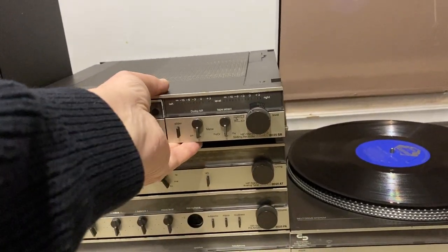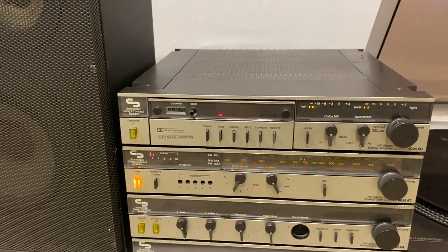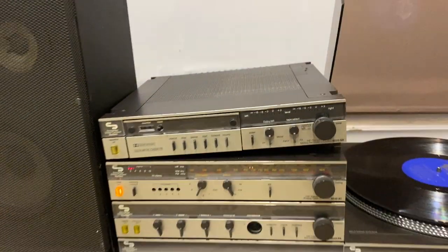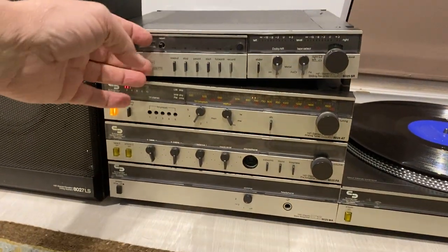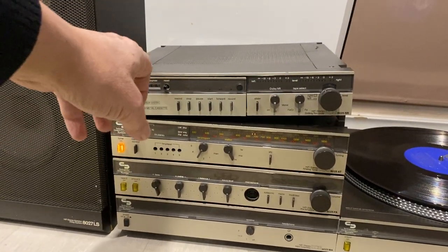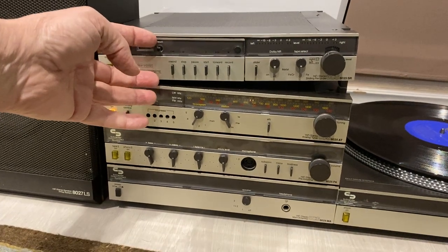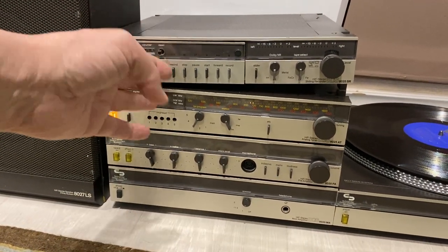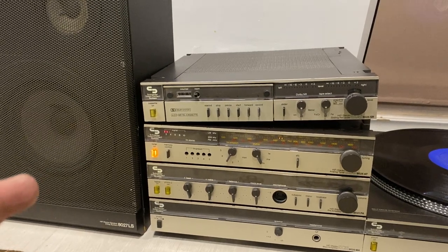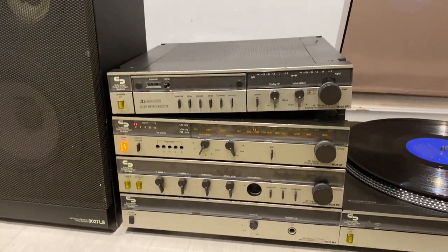Let me just flop this tape deck into place here. You can see that's the motor going on that, which was a bit of a pain to take off — I just basically disconnect it and lift it that way. It's a sliding model: this slides out like that and you pop your tape deck in the top that way and it slides back in and the functions work. I did get this open and I did get a belt on here — it wasn't the right belt, but it was tight enough for it to function. The door did slide open and shut. But on play, there's an idler wheel system in here which is actually a gear system, and that had completely disintegrated. So that would need replacing, along with a proper belt, to get this to work properly.